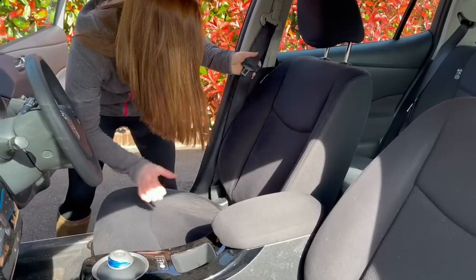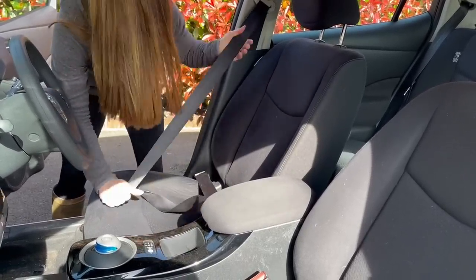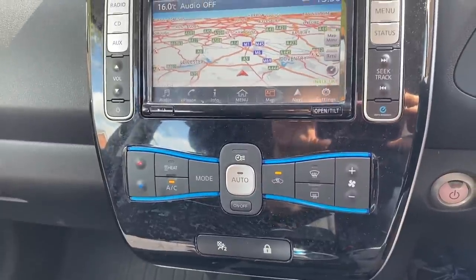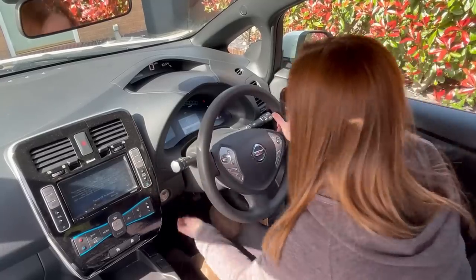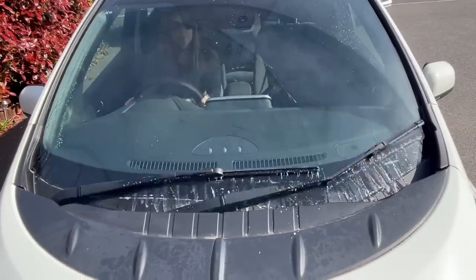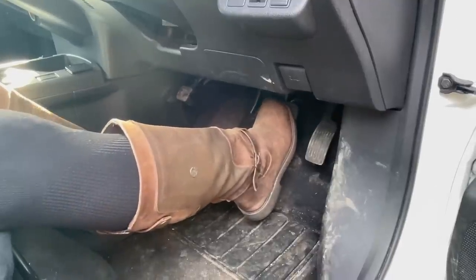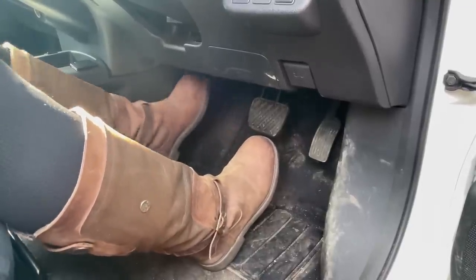Inside the Leaf I'm checking the seats are secure and the slide and lock mechanism works okay. The seat belts are in good condition, they latch and retract correctly, and the rear bench locks in fully. Now I'm checking the interior controls and making sure that air conditioning and heater are working, the steering column rake adjustment and all the stalks operate as they should. I'm also doing a quick check of the pedal rubbers, checking for excessive brake pedal travel and looking for reserve travel on the foot brake — everything feels okay.